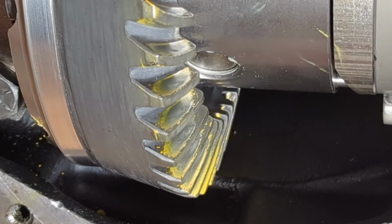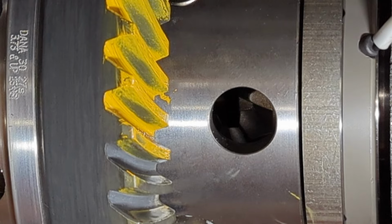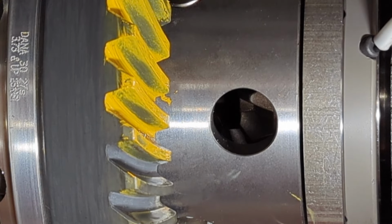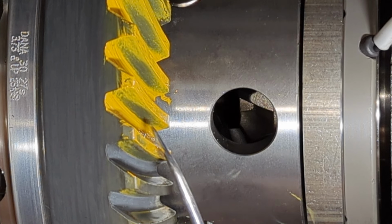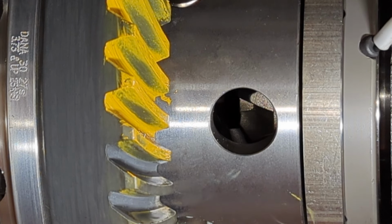Now the problem is, we come to the back side, and we look at the drive side pattern now, and it looks like it's showing that we still might be just a tad bit deep. You see how you get that harsh line at the bottom that we talked about, and then you get the sunset kind of frowny face looking thing there, but we do have that real thin piece of paint up top, but it's not out by much.